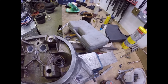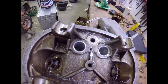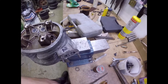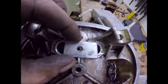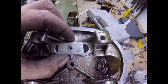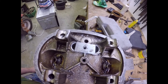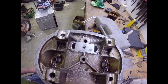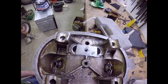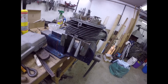Right folks, Thursday two o'clock. We've got two push rod tubes fitted - not permanently yet, just in place. We've got a hole drilled in between them, tapped M6, and I'm just about to make a little plate which fits over there, flush down to the cylinder head, spectacle-shaped to retain the two push rod tubes should the retainer let go and they come loose. This is just a bit of insurance.